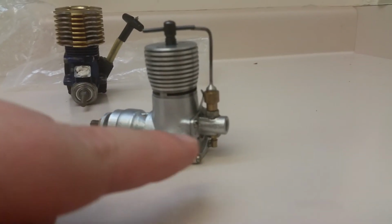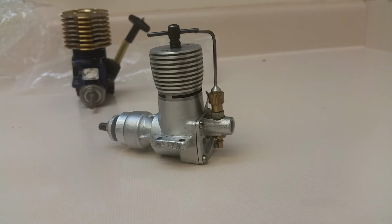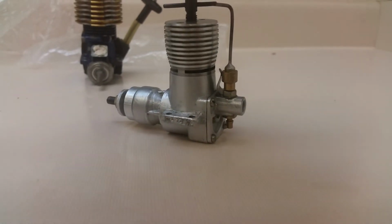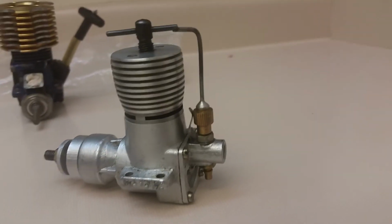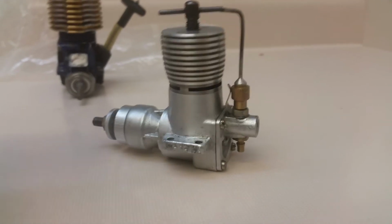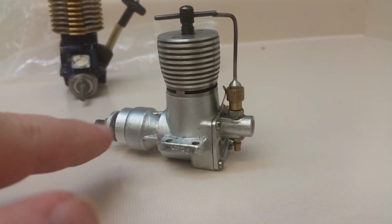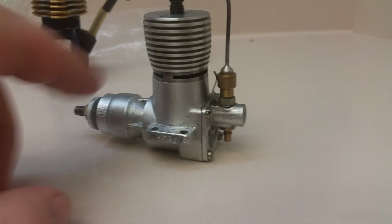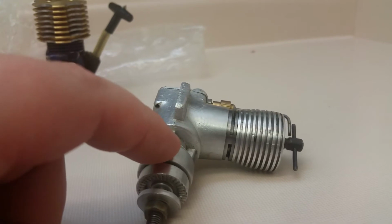That means that when the piston's moving down and creating pressure in here, that disc valve has got all that slop in it, and it's kind of forcing some of the fuel back. This engine's really strange like that, because usually when you lean the fuel mixture, it wants to go faster, like that engine will. This one's the opposite. The more you turn the fuel open, the faster it goes, because it has that leaky disc valve and a leaky front bearing.